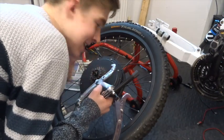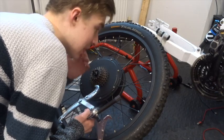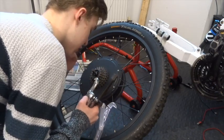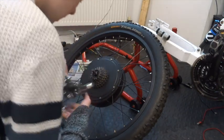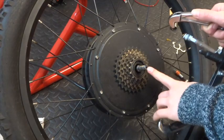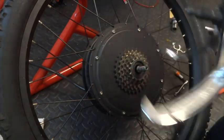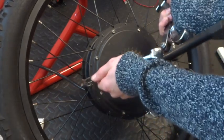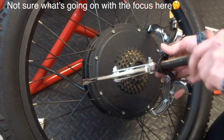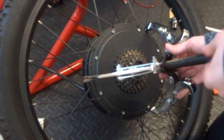The other way, which is what I'm going to do, is to use one of these — they're called gear pullers. This is an eight-inch gear puller. I tried looking everywhere on the internet to find out what size to use and couldn't find any, so I bought the biggest one I could. An eight-inch gear puller will do the job; you might get away with a six-inch, I'm not sure. The way it works is that this part goes over a little dimple in the axle, and the arms fit around the motor underneath the ledge, evenly spread around.